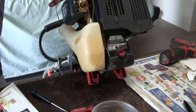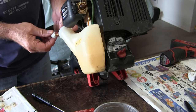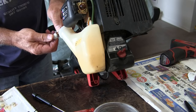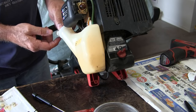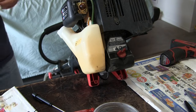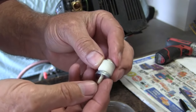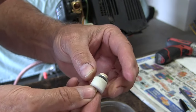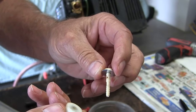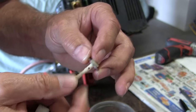Push the fuel line down a little bit while I'm pulling out with a wire. So it's weighted. I am connected. For that to be plugged would have to be such fine particles, it'd almost be like talcum powder. Filter — remove the washers. There it is. So that hole's clean.